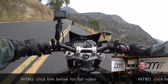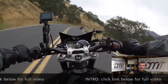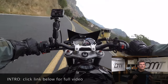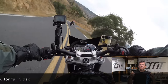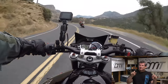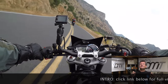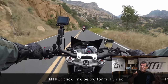On this first ride, the biggest issue is that when I initiate the turn — I initiate a counter-steering input — it takes a heartbeat before the bike actually begins to turn. So I had to do a bit of a timing game. I had to guess how much before I wanted the bike to turn to make the steering input, because I knew where I wanted the bike to turn; I just had to guess how much before that point to make the input.